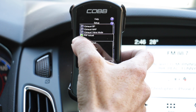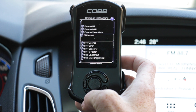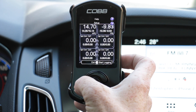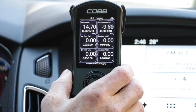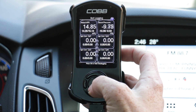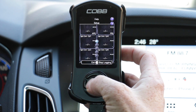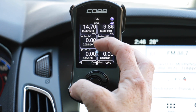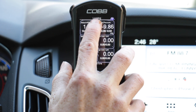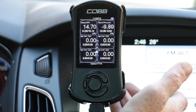Once I get to FRP Actual, you can see it's lit up green — I'm going to deselect that parameter. Now that I've deselected it, I'm going to hit the back button. My gauges will come back up saying 'not logging.' Now I'm going to try to log again by hitting the center Enter button. With the blue dots going up and it stating that it's logging, it is working — we are currently data logging at idle.